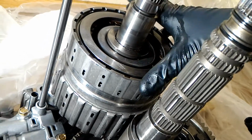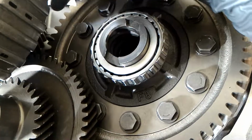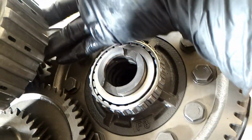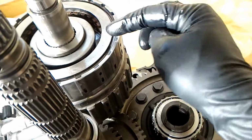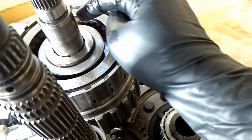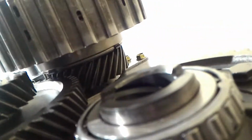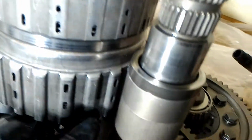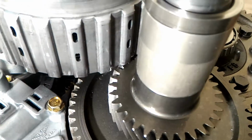Alright, so I held this and kind of lifted it up while I spun the sprag gears, the hub and sprag gears, because you have to line up the indexes in the disc here, so it slides over the gear. Not this gear, but the one above it. And how you know it's all the way down is, I think you just look at here, the gap clearance between this and here, because obviously they can't rub against each other.